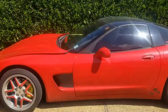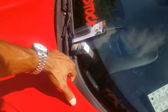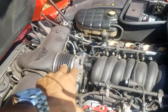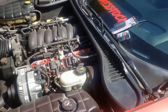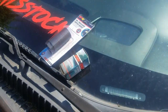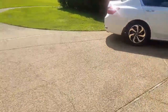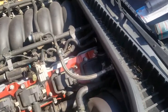Time to figure out how to get this old one out. There's a couple of ways. One way is to remove the whole intake - you'd have to remove all of that, undo all of this, take the whole intake off, buy new gaskets, and all that. The sensor is behind it. The other way is to use a U-joint socket, and you reach around and can kind of get to it, barely.